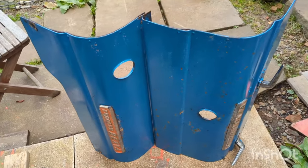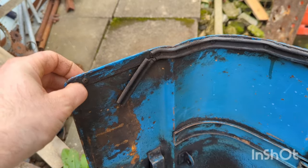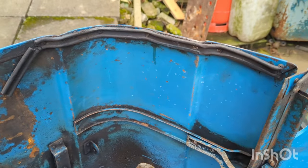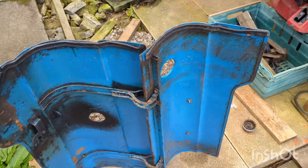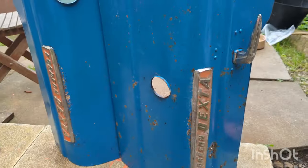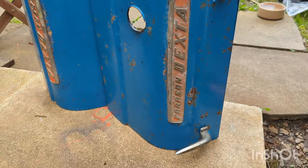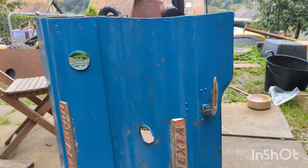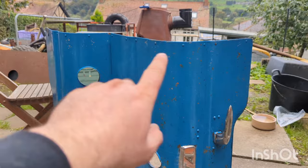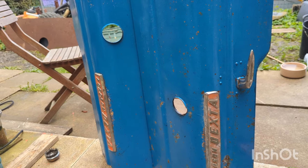I'm just having a quick look at how the bonnet is to begin with. As you can see, the inside is pretty dirty and the original rubber seal and rivets — well, the rivets are still there but the rubber seal is totally perished. I've bought a replacement kit for that and I'll be changing the seal out once I've done the paint on this bonnet. Both emblems will need a bit of fettling and ideally painted internally with the Ford orange to match how they should have been originally. I'll drill out all the rivets and replace them with new ones after the paintwork, so the rivets stay nice and silver.